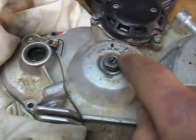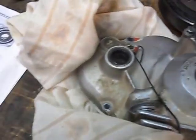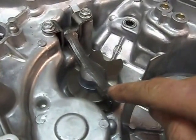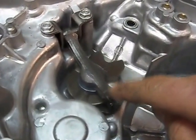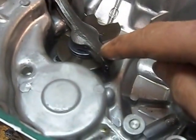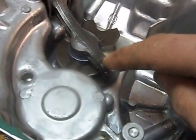And I went clockwise, and it says quarter turn, but it doesn't make squat. It doesn't even allow this arm here that goes on the button for the manual clutch to make any difference — a quarter of a turn out. And I went about a turn out, and it makes a big difference.